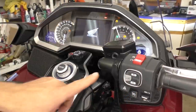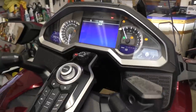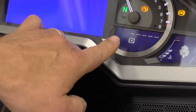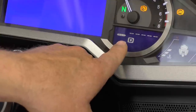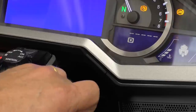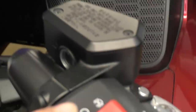Now push D, D, N, D, N. You'll notice the indicator down here starts flashing, which indicates the clutch initialization procedure is ready to go and Drive is on. If the engine oil temperature was not up to temperature, you'd get either a small L or a big L indicating the oil temperature is not up to temperature.